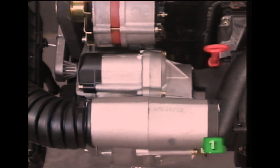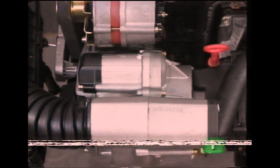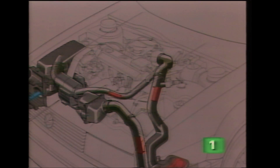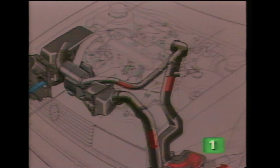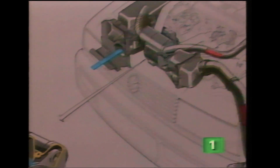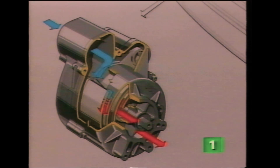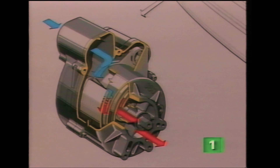This means that the G-charger is particularly well suited to engines under 2000 cc. Further advantages include its quiet operation and relatively simple adaptation to exhaust emission control systems. The G-charger was used in preference to other types of superchargers because of its high efficiency and durability.